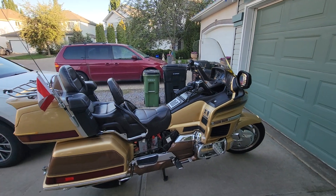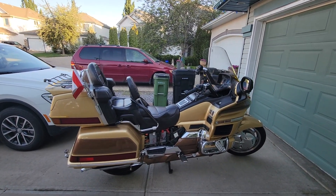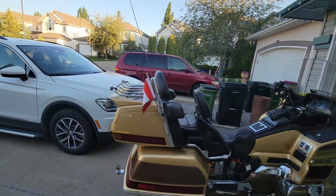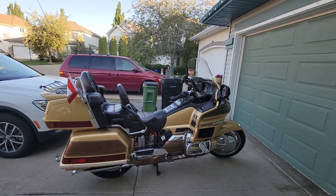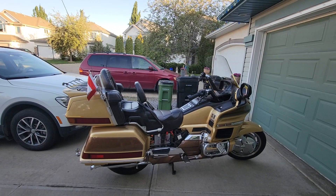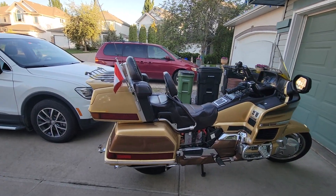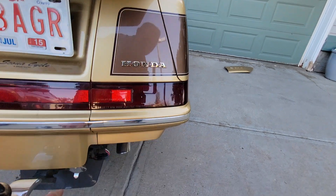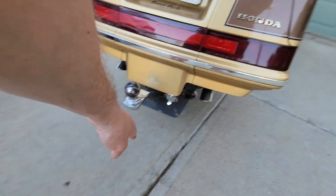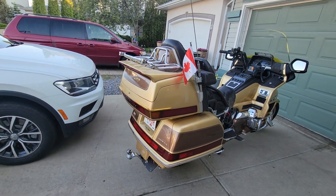In total, it took us about 4 or 5 hours to do this because we soldered all the connections, shrink-wrapped, and made it nice and weather-proof. Now, because I decided to put the extra light on the side, those were originally supposed to go on the trailer. So I have two more lights coming from Fort Nine through Custom Dynamics — everything will be in the description. I've ordered two more for the trailer and we're going to do the same thing: run the wiring down the back of the bike, with a separate plug and a matching plug on the trailer, then wiring under the trailer to two Custom Dynamics LED lights at the back.